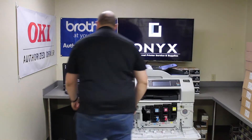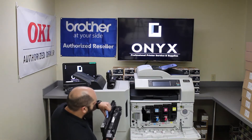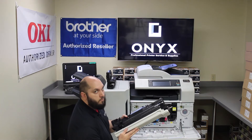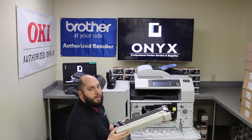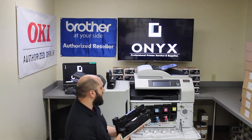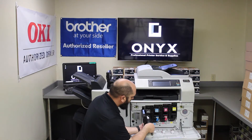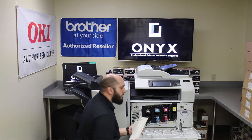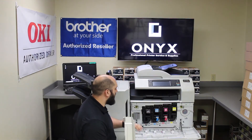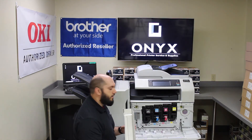We're going to grab our new drum — we've already unpacked one. Once you unpack it, depending on where you get your drum from, a lot of them will have a hard plastic cover that covers the drum. You should always leave that on until you actually install it. When you slide this up into the machine, you can actually push the cartridge right off of that guard straight into the machine without having to take this off. It's a good way to make sure that your drum stays covered and protected all the way until it gets inside the machine, so no scratches or damage happens while you install it.